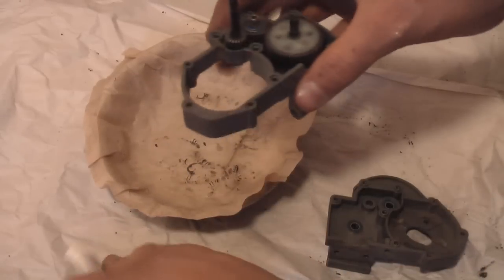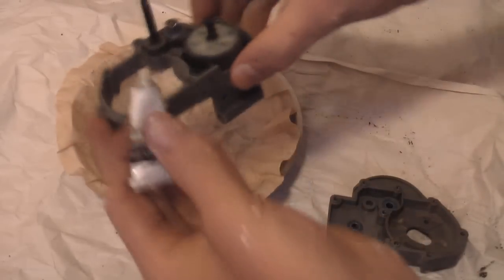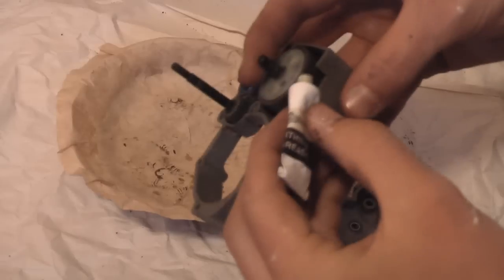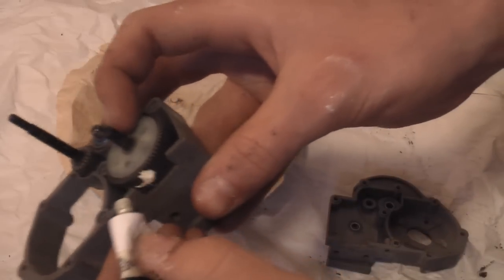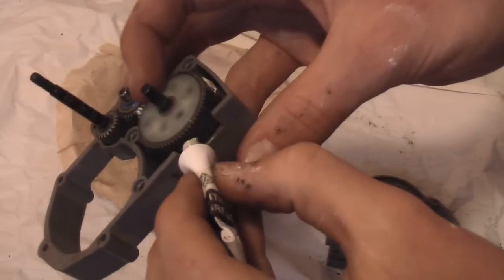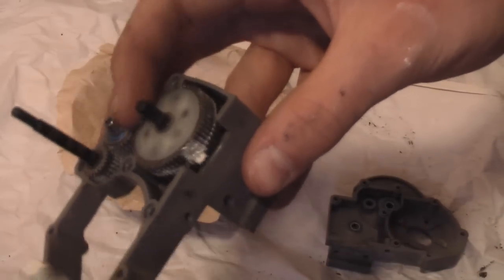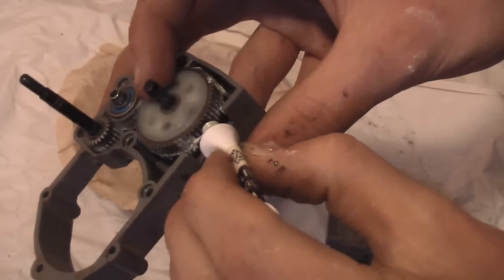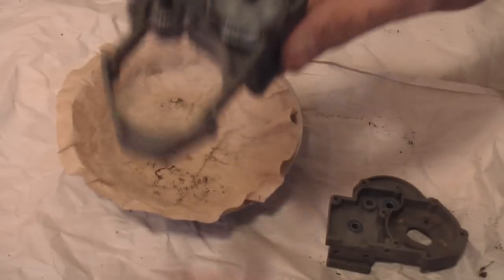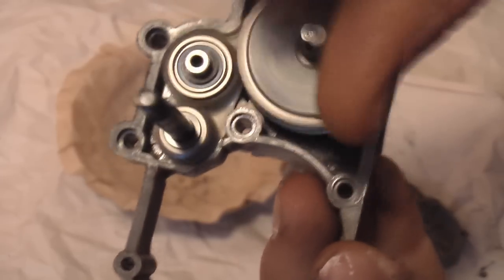Before putting it back together, apply some grease. You don't want to apply too much — just enough to make the gears spin really smoothly. Some people pack it full just like the diff — do not do that. You might have heat issues and it'll be hard on the case. Just make a little strip of grease on the gear, spin it about three-quarters of a turn, add another little strip. Make sure the strip goes all the way up and down on the tooth face, because it doesn't spread the way you might think. Apply a couple more small areas — it'll spread from gear to gear. Put on enough so that if you spin it you can just see it come through.